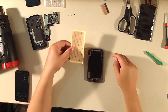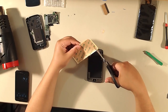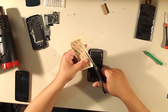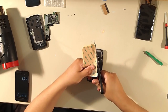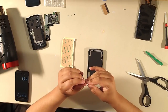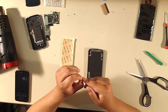Now we're going to proceed to glue down the two-way tape. I use the edge here for the sides of the frame. I'm going to fast forward this part, but just to show you how it starts — make sure you put two-way tape all along the edge. The more complete you do this part, the better the screen is going to hold. There's no adhesive underneath the LCD, so the entire screen is held on only by the two-way tape along the edge of the frame.